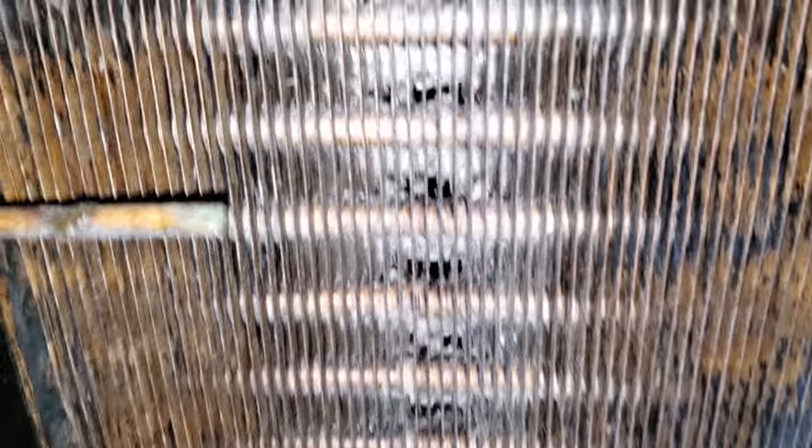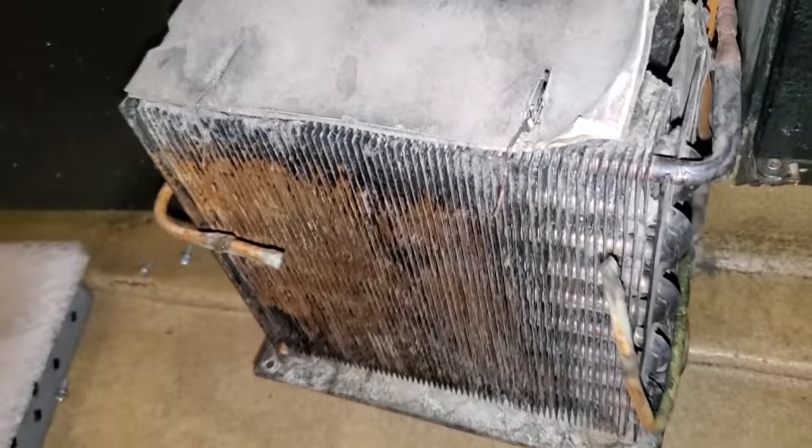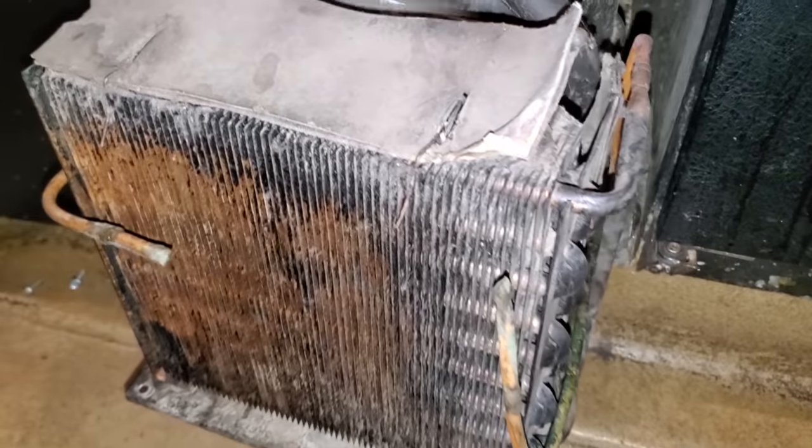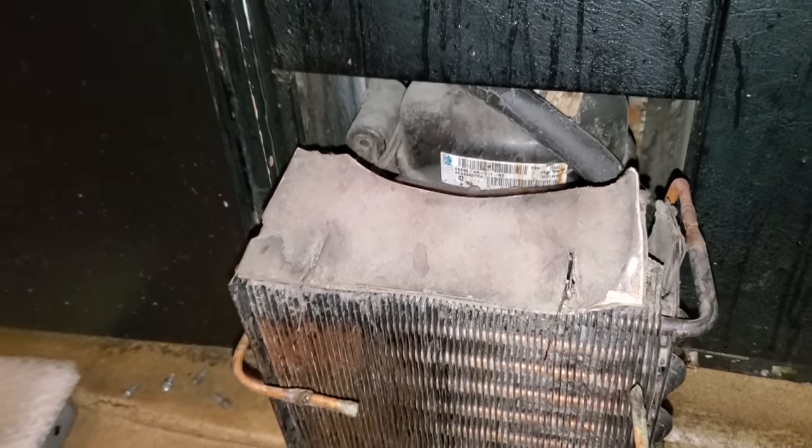There it went. The condenser had a nice filter on it, but it's actually pretty dirty inside. Just shows you that just because the surface is clean doesn't mean the condenser is clean all the way through. We're going to go ahead and try to get this out. There's not a lot of room in here and we've got to investigate the starting components and get to the side of the compressor to test if it's bad.